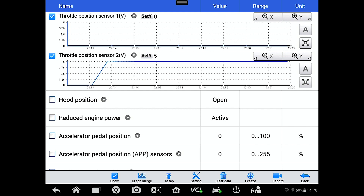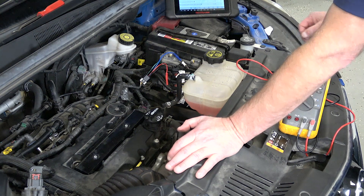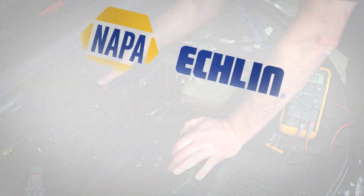This confirms that the wiring between the throttle body and the ECM is good, and that the ECM is able to see and react to the changing signals. That tells us we are looking at a faulty throttle body. This car will get a new throttle body, but once replaced, don't forget to perform the needed electronic throttle body relearn afterwards.